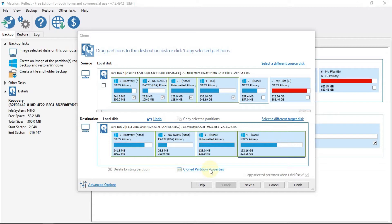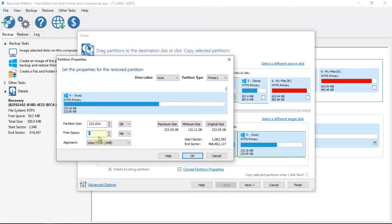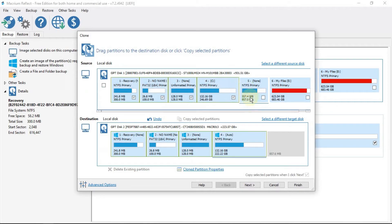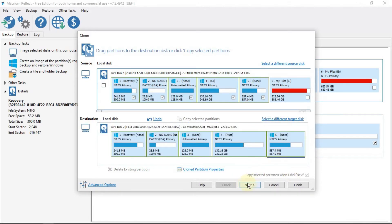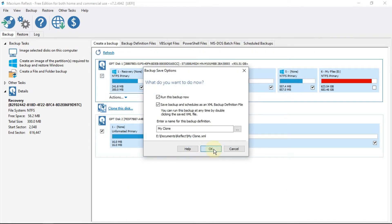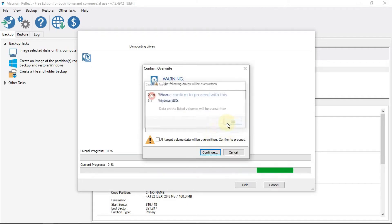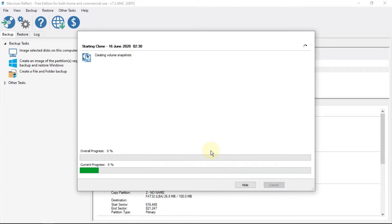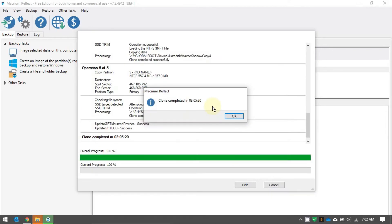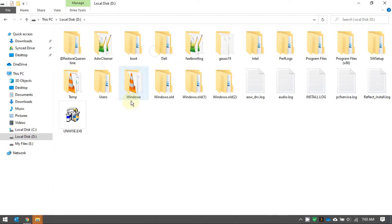However, since I did not know this, I had to free up space manually to make room for the last partition. You can do this by going into the clone partition properties and adjusting the free space manually so that the last partition can fit in. In this case, I freed up 857 MB since that is the size of the last partition. Now click on next, skip the schedule screen since we are doing it only once, and review the summary. You can also skip saving the backup definition. You will then see a warning saying that the data on the drive will be overwritten — confirm and proceed. This begins the cloning procedure, and in my case it took almost 3 hours.